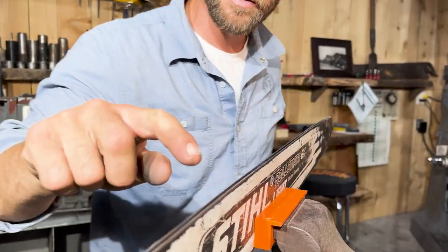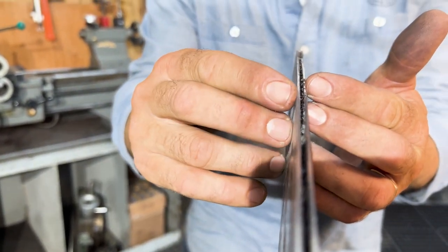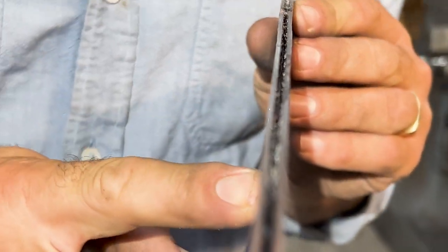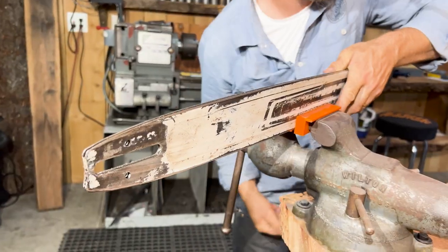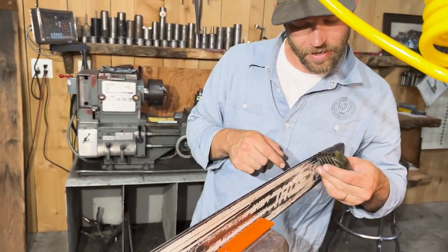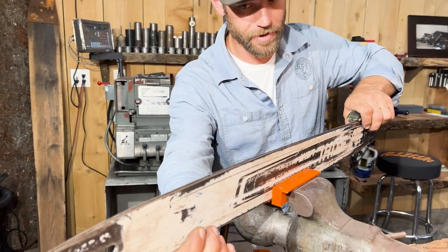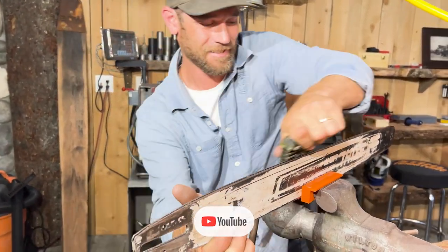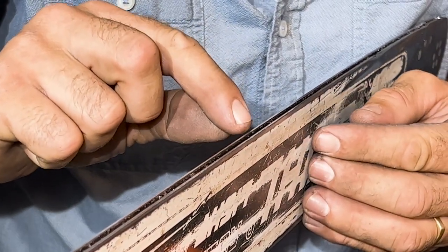You might be able to see areas with the shine from the light where it's touching one rail but not another — it's bringing that portion of the rail down to match. This old bar — I'm not going to go too crazy on it. For some reason this bar has that chunk out on the same side and same area on both top and bottom, which has to be something done in the factory. That side looks a little better — I'm definitely taking more off one rail than the other, so it should perform better.